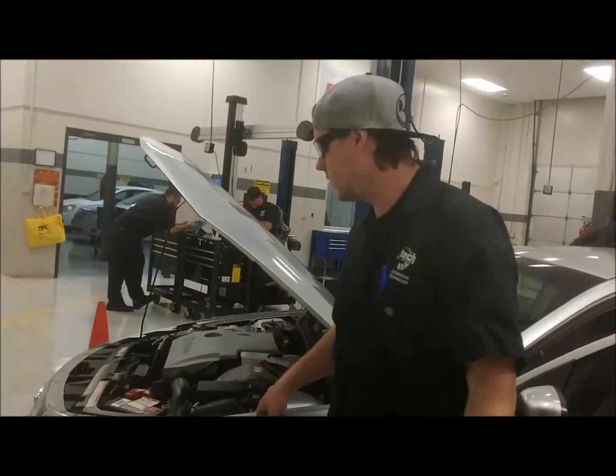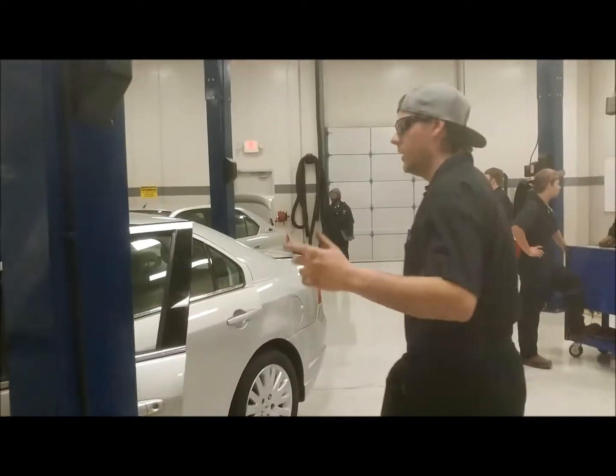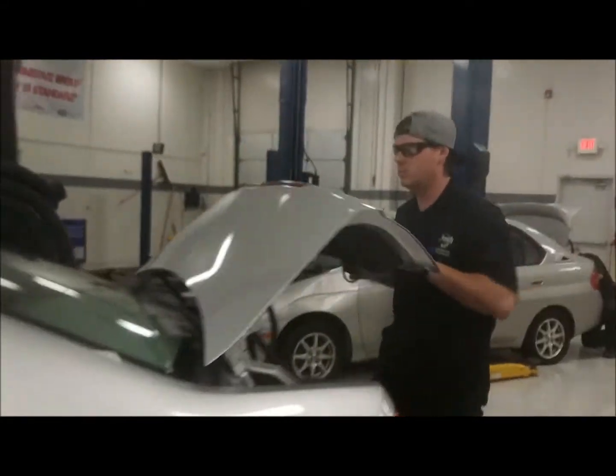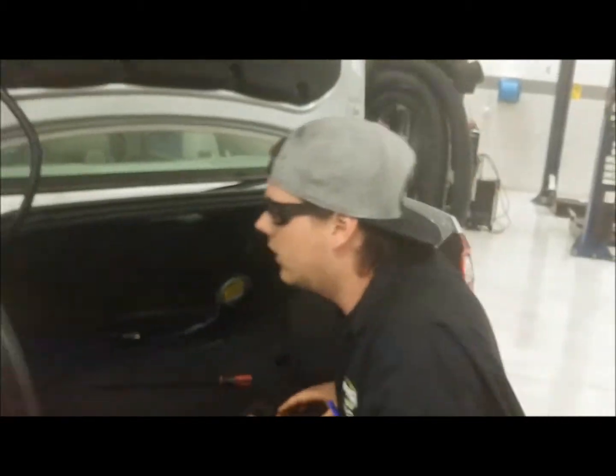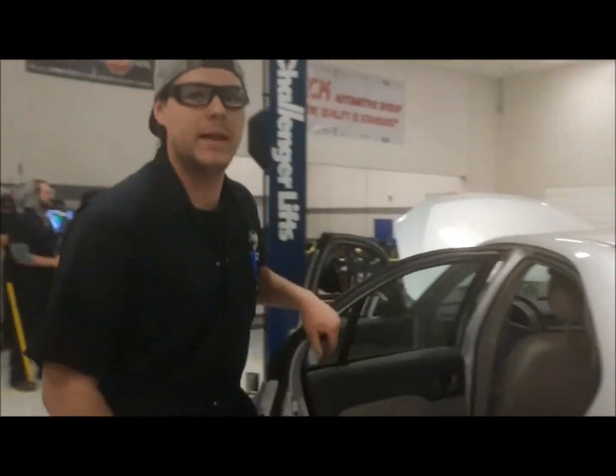The first of our two vehicles, we've got our Ford Fusion. It's pretty basic, so we're going to make our way to the back. What you have to do is start in the trunk — you've got to pull this trim down, and there's a small tab right about under where this bracket is. The reason it's so difficult to drop the back seat is because they don't want anyone to be able to just drop it and reach back and start playing with wires.